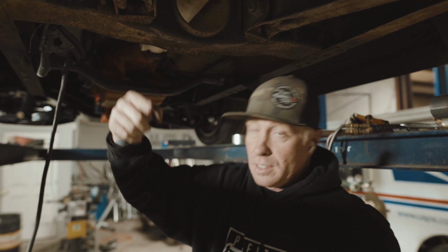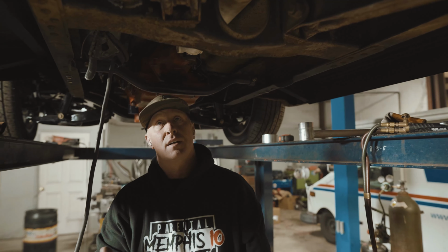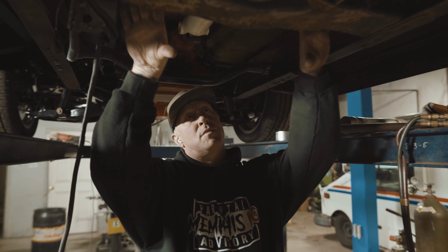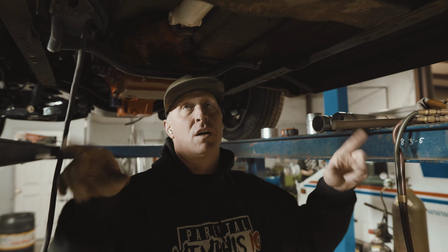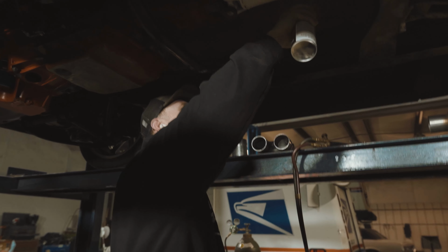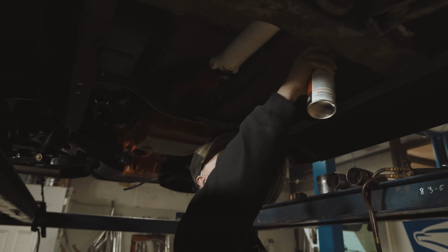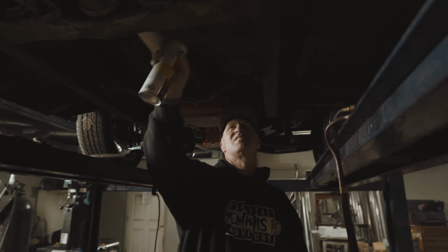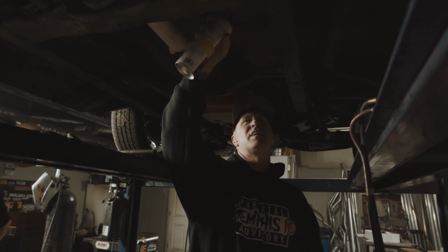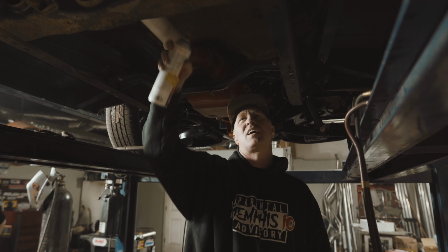So now we'll go through it. We just put the pipe in there, with some bracing back in it. He's later planning on putting in a complete crossmember that's made with the exhaust cutouts in it. I always use this bed liner in a can instead of the undercoating stuff. I like the undercoating, but it stays rubbery. It never completely sets up. I use this stuff here. It sets up really hard and still protects it.